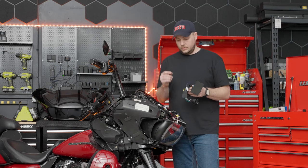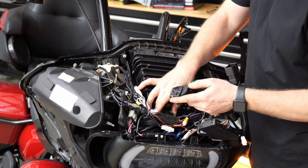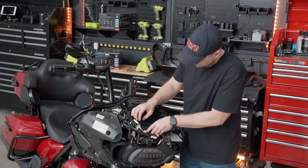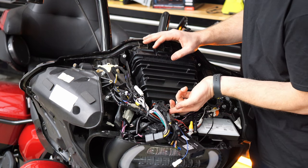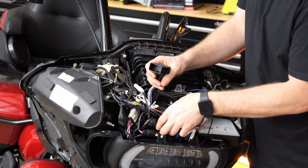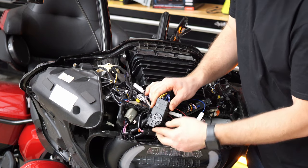To do that, it's really simple. You see we have a factory-looking connector on each end. We're going to start with this connection — it goes right to the back of the radio. This customer already has an aftermarket amplifier, so there's a lot of extra wiring going on, but we'll work around it. Line the connector up, push it into the locking tab hooks, and push it to the top dead center position. The female side of the connector goes to the factory plug that we disconnected from the factory radio, so we'll line that connector up and swivel it until it locks into place.